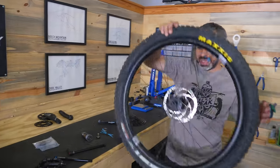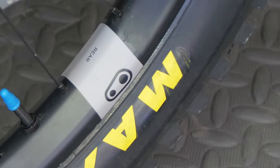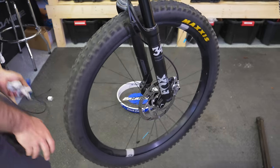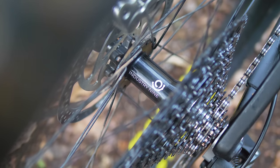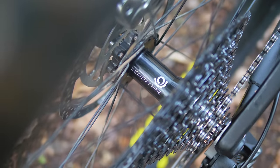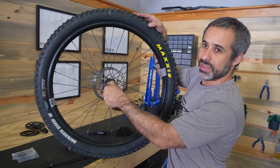What makes these wheels different is that they're tuned. The rear wheel has tighter spokes than the front wheel. The front wheel actually has some compliance, so when you're going into turns it flexes a little bit and gives you some kind of side suspension. I thought it was kind of a marketing ploy, and then I rode them for about a month. These wheels feel different to me — I would actually love to run these on all my bikes. These Synthesis wheels came higher spec, so they actually have Industry Nine hubs on them.